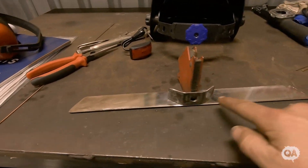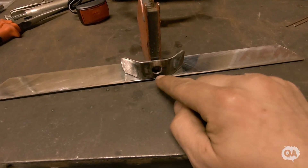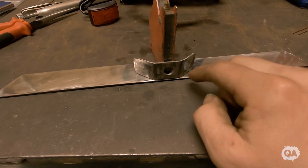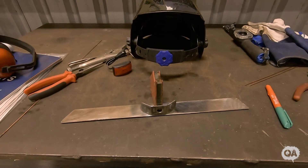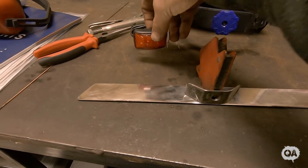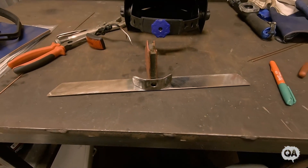Quick tip: red lights don't hurt your vision at night. I'm going to stick this on the roof — a little red light — so we can see the gauges and stuff that don't have lights in them. Making a quick easy little mount to go across the roll bars. The switch will go in here, folded it around so at night you don't cut your fingers — nice and smooth. I'll quickly weld that on, light goes underneath, drill some holes and we're ready to rock and roll.